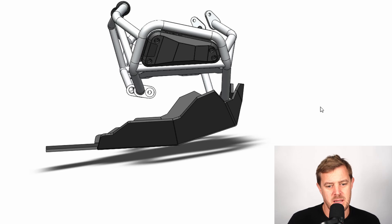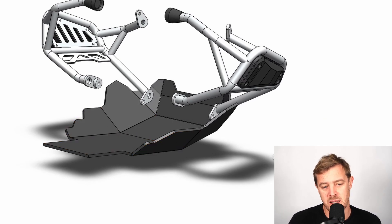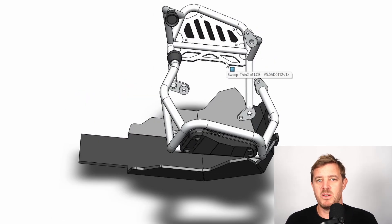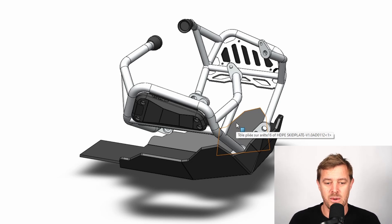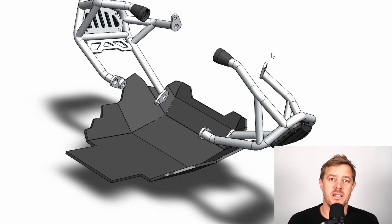This is the 3D model of the design — a base model without the screw holes and reinforcements, which are in a separate model for speed optimization. The design goes into the casing with a three-point connection system. The third bar I call the 'emotional bar' — from the concept it should flex. If you drop the bike on the piston, you want this bar and surrounding structure to absorb the energy before it goes into these bolt heads, so it doesn't rip the engine block or deform the frame.